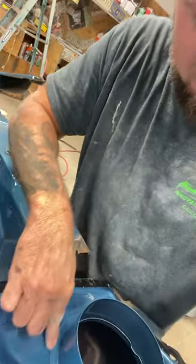So in theory, in concept, there's nothing down in there. You can spray paint in there, you can pour paint in there, you can POR-15 it, but you gotta do something, because if you don't do anything, then that E-coat is gonna come off and you're gonna be right back in the same situation you are now, 15, 20 years from now. The water is going to puddle right here, get underneath that seam right there, rot your cowl out, and then rot your floor pans out.